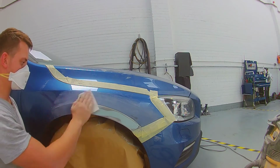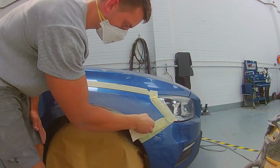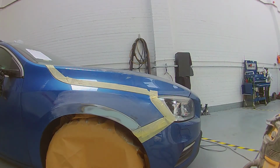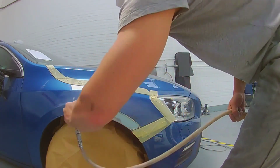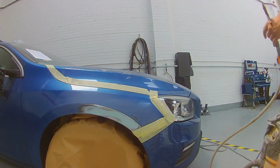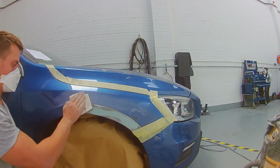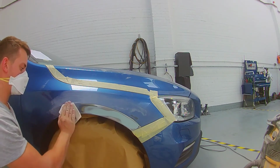So I've got some 500 grit on a softback sanding sponge, and I'm just going over them 320 grit scratches. That's it, edges, all surrounding area where any primer will go into, and that helps for when I do take the primer back and go into the blocking and sanding stages, that once the primer's been exposed over that 500 grit area, them scratches will be easy to remove with the orbital.